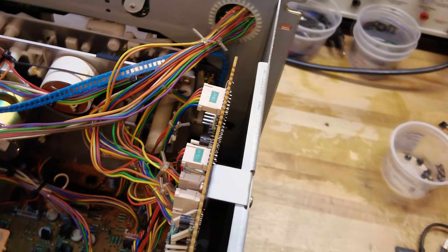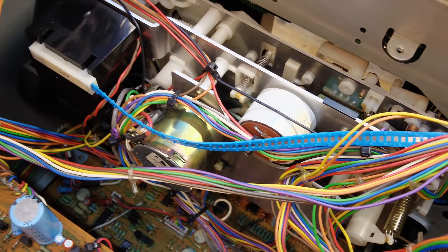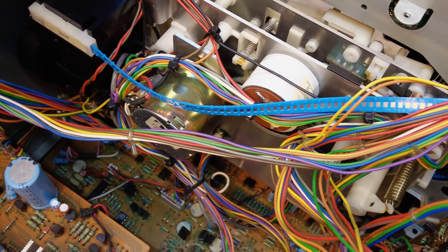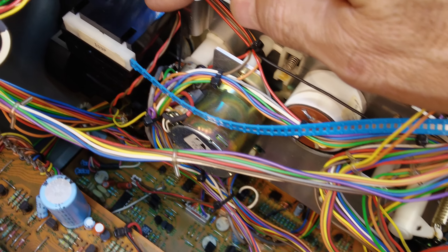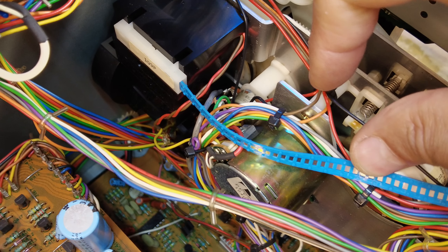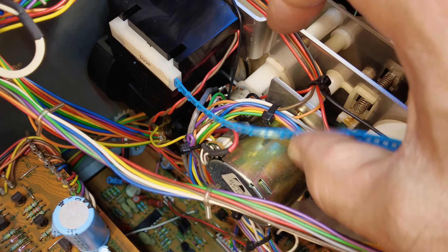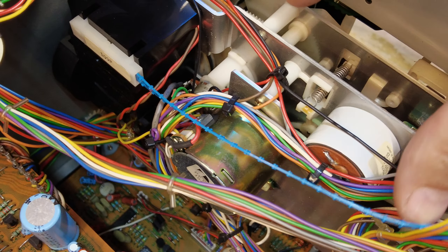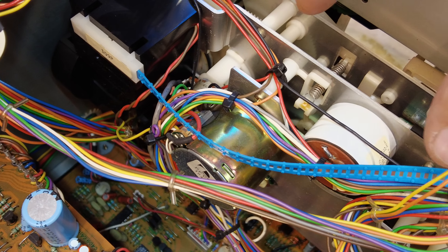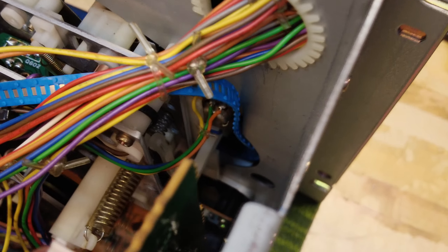It's a really nice setup. The drive mechanism has some commonality with other tape decks, including the Dragon. It looks like they're using the exact same box here for the azimuth that they would in all the other tape decks. There's a motor in there and a cable actuator that moves the head for azimuth adjustment. The motor uses this slide cable to move the head, which wraps all the way down to the bottom of the unit.